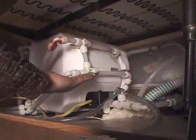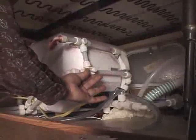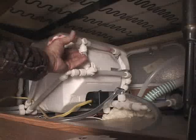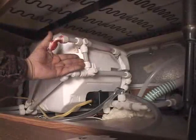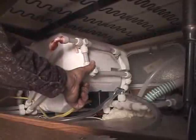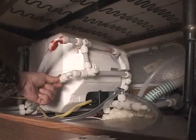What we have here is the water heater and the water heater bypass valves. While you're winterizing you'll have to turn these valves so that they face one another. Notice that one is on the inside and one is on the outside. When they're facing one another the water heater is bypassed. When they're facing the water line it shows the direction of flow and it is not bypassed. To winterize, have the valves facing one another so that no water will flow into the water heater.